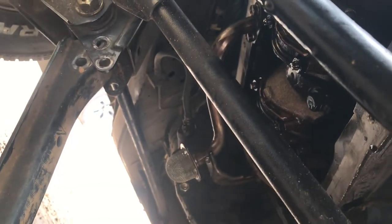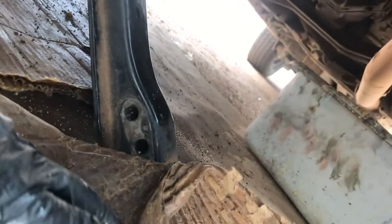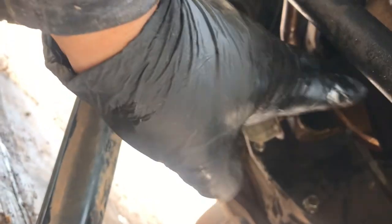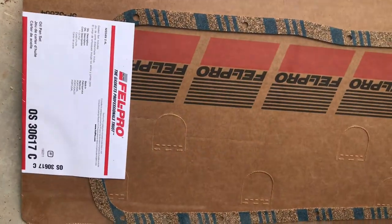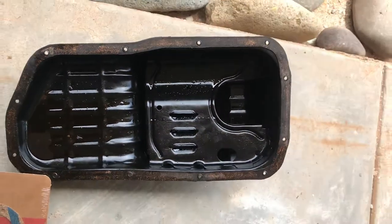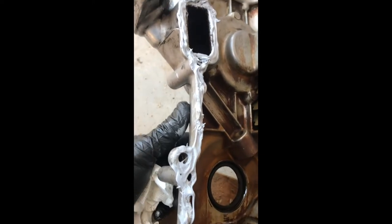Next I'm going to put the oil pan back. To get reach to the oil pan, you have to take this bracket off — there are two bolts and nuts. I left it on one side. I'll put a new gasket in the oil pan and torque the bolts from 6 to 8 foot-pound. You don't need any silicone — just the gasket by itself. If it starts moving you can put a little silicone to hold it in place. I made the gasket using silicone so it went around.